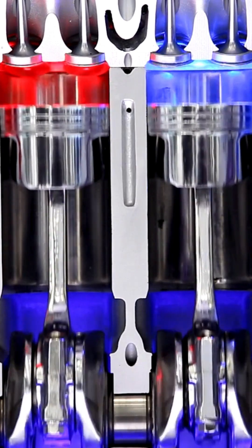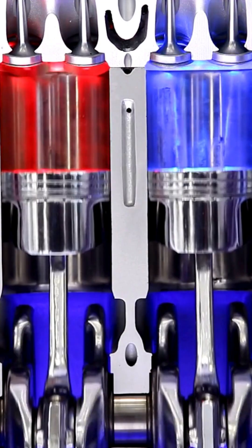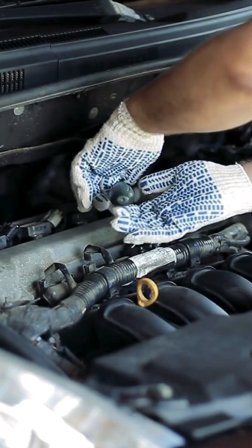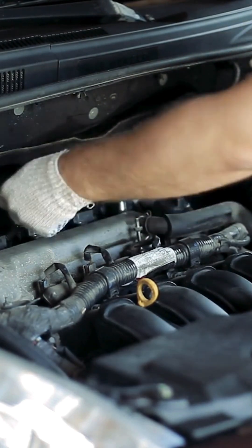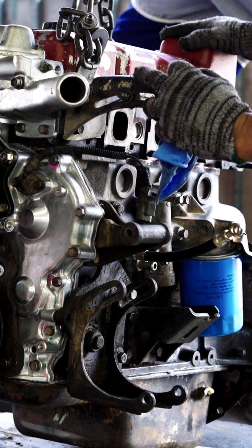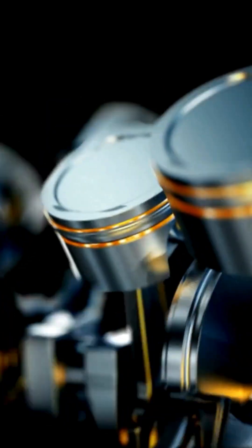Those are some things to consider about your coolant system and how important it is. Anytime this takes place, these damages are irreversible — it's not like you can just top off the coolant and go on your way. These are things that have to be addressed, and in this case require a major overhaul. A lot of folks might say you could hand hone or ball hone it and put another piston in, but those scoring marks are well ten-thousandths deep at least, past the point of any in-vehicle repair. The engine block has to come out and go to a machine shop.